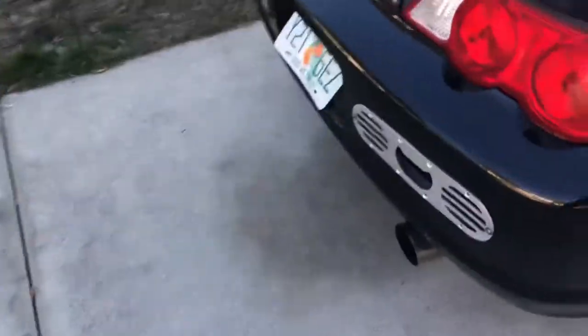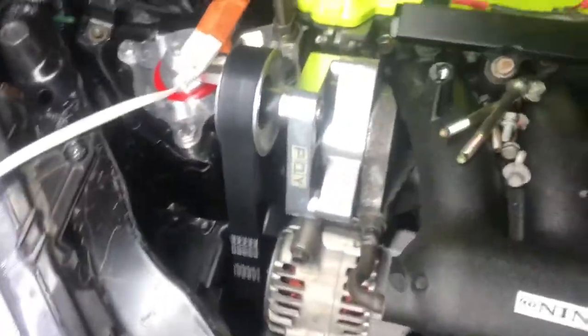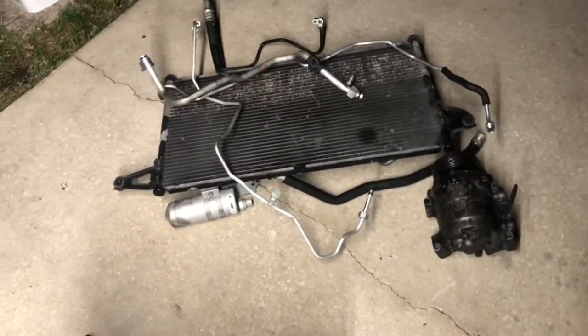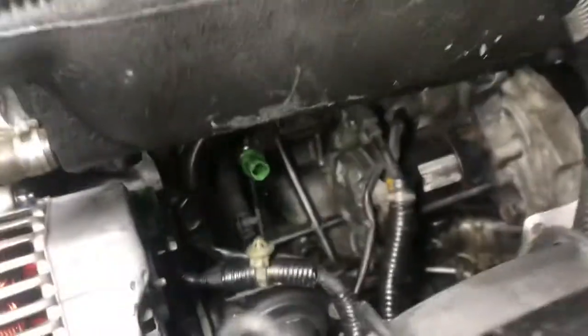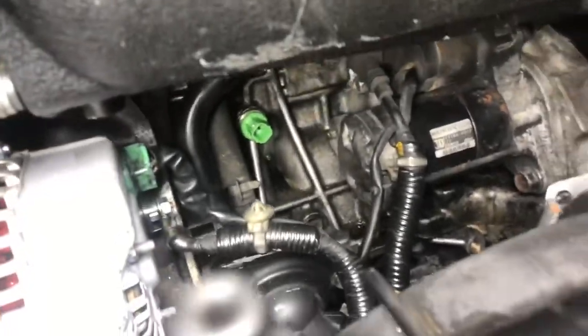I'm about to go for a drive once it warms up. I was recording without y'all but you know, I did the power steering delete so I figured — you know what — let's delete the AC too. My whole AC system is out anyway. I disconnected the lines and it was pretty easy. The hardest part is the compressor — you do not have to drop the subframe, you just need a 12mm wrench and a regular wrench, and you need patience and some arm strength. I'm already cleaning down there, it's filthy. There's a new knock sensor but I don't have the deep socket to put it in, so I have to wait for Ninja to come.